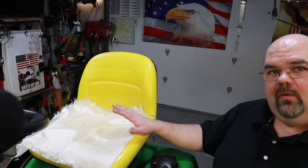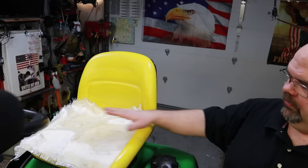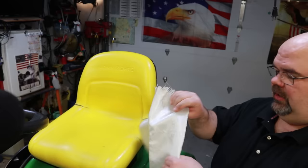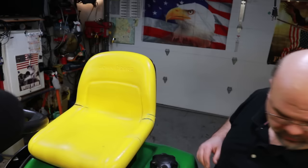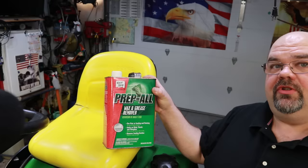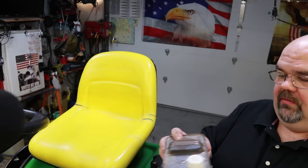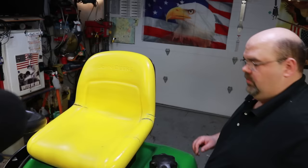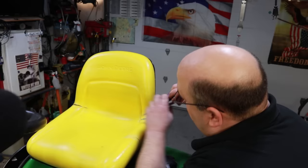That fiberglass material is left over from a hood repair project — I'll put a link to that video. Anyway, once you've got it sanded and the mesh is down in there, take Prep-All — and I get no endorsements from anything in this video, this is all stuff I purchased myself. It gives the material somewhere to stick that doesn't have any contamination. It won't hurt the vinyl or the paint. Put it on a rag and go well past the area you're working on, clean all the way down to the edge.